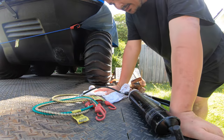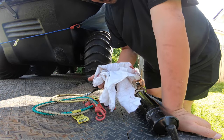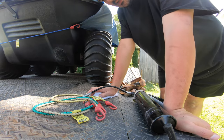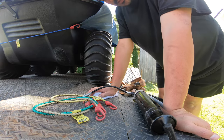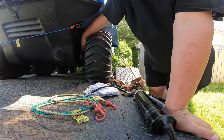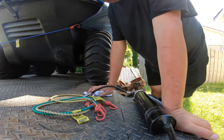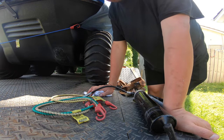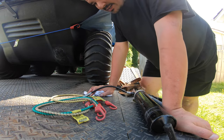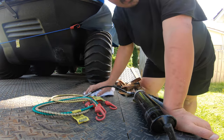And we're done. Now, one of the reasons you wipe it with a rag is you don't want particles of sand getting pushed in with the grease, because that's going to mess things up big time. You'll definitely be changing bearings if that happens. Now, I'm taking the time to inspect the cork seals, which are still pretty good. This thing has really only seen about a year's service at this point, or a little bit longer. And I'm fairly subdued with it, aside from when the missus drives.